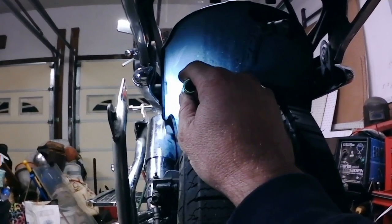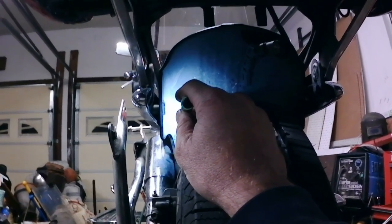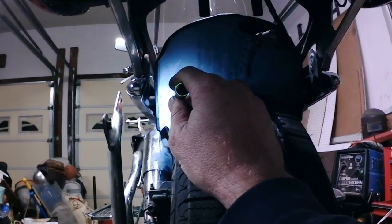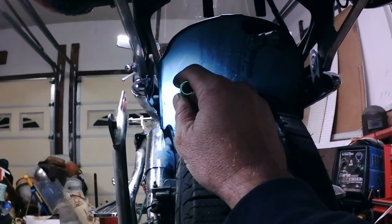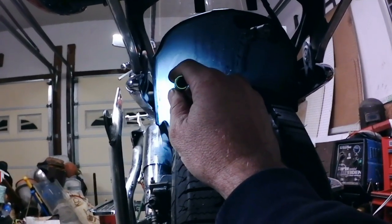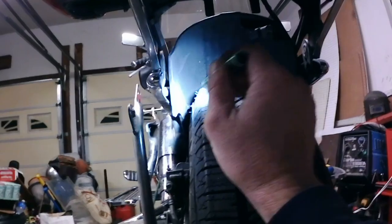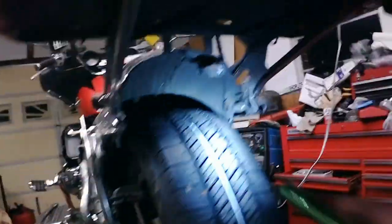The problem that I'm running into on this bike is that, unfortunately, someone decided to jam some standard thread bolts, or some SAE bolts, in metric holes, and that doesn't work well. And unfortunately, for the last couple years, I've had to deal with issues with the bag mounts vibrating loose because the threads were all jacked up. So, what I'm going to do to change that up, on the front, on all these bolts, I'm going to run the bolts from the inside to the outside, and then I'm going to put the nuts on the outside. Long story, I'll explain here in a minute.